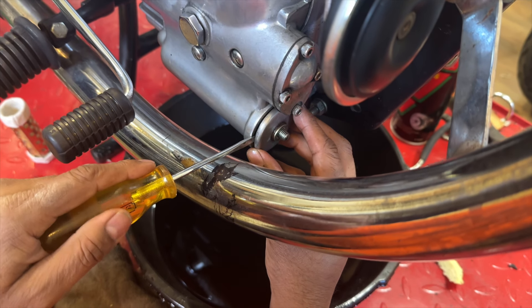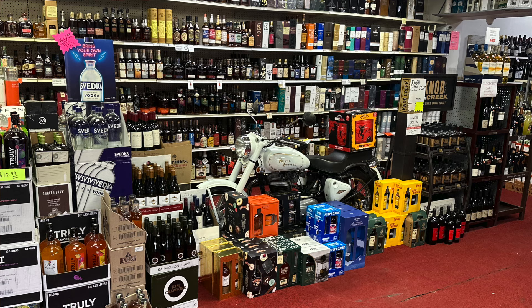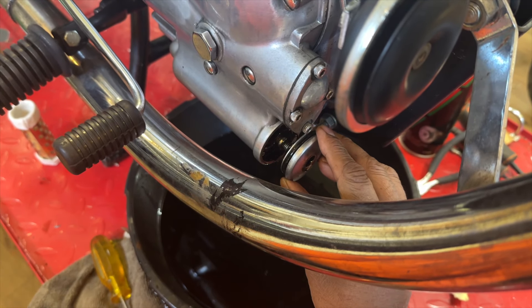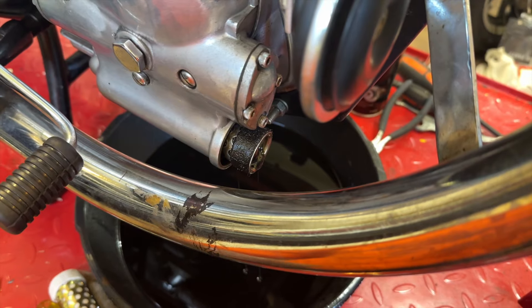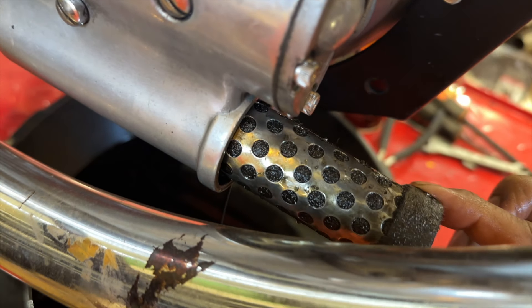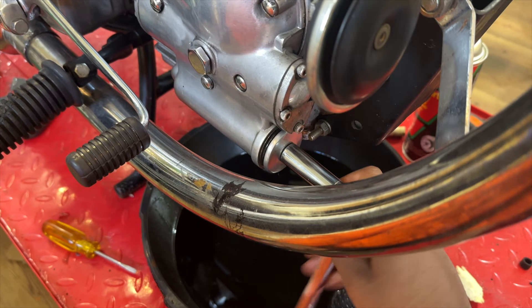The next step was to put oil back into the bike. If you guys remember, we parked this motorcycle inside of a liquor store for the winter and now it's finally getting un-winterized. The very first step was to change the oil filter, which I did not do previously — it's located in this weird position next to the exhaust. You can clean the filters or just change the felt from inside, but they were really cheap, like $10 for six of them, so I just bought brand new ones and put them back on.